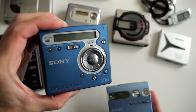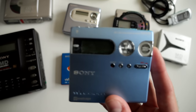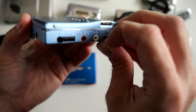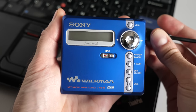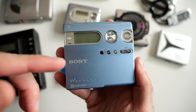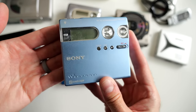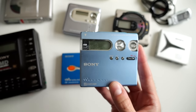You could get Minidisc hardware that was MDLP compatible but didn't have NetMD. That said, NetMD is really probably the biggest impact on the Minidisc ecosystem, and what a lot of people today are going to want to look for. The main reason why is it added a USB port to the recorder. For the first time, you could hook one of these directly up to your computer and, using software, digitally copy the audio straight onto a disc. It would bring over the track title and album information, and LP2 doubled the recording time, while LP4 quadrupled it — up to 320 minutes of music on a standard 80-minute disc.